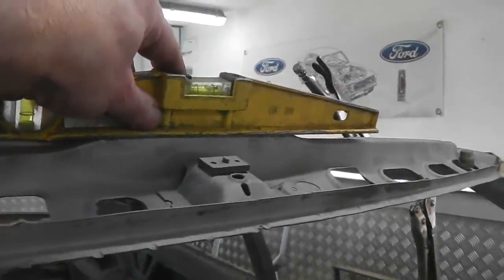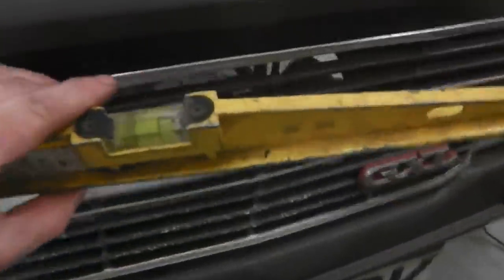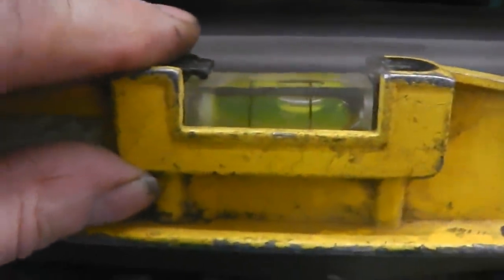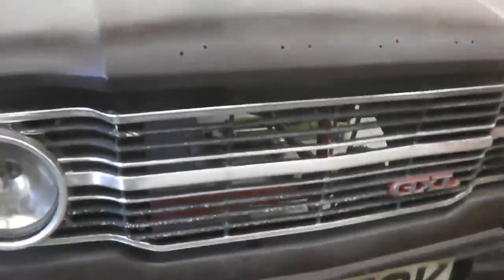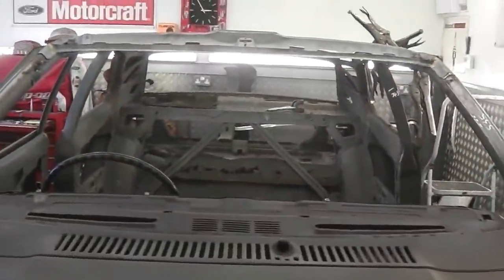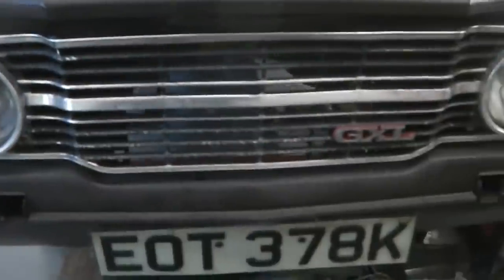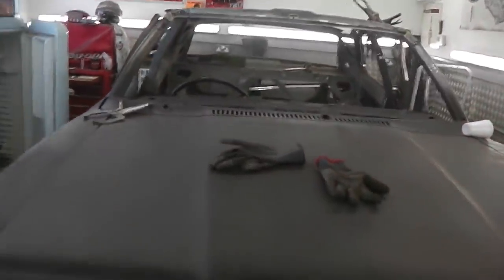We've definitely got it. A very slight bend to the right, just touching the black. And on the slam panel, can't really show you because I can't get my hands in, but it is the same. It's a very slight bend to the right. You'll have to take my word for it. There we go, we've got it on this. It means everything's level, it even means the front panels are level. I never actually checked that, but there wouldn't have been really any need to. You might think I'm over obsessing with it, but that top cross member spar is completely relative to the rest of the car. So if the car isn't square, then that's not square to go with it, if you know what I mean by that.